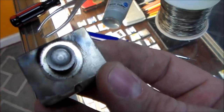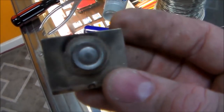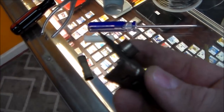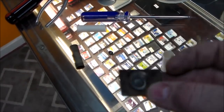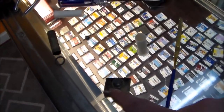The last thing that it can possibly be if you have trouble is the coil stop. The coil stop is just a little metal piece that the plunger hits when it pulls in. Sometimes these will give you trouble — you can see how the end of it's not flat. Sometimes if you have problems, the coil stop is just so worn that it needs to be replaced. A good place to buy all this stuff for electromechanical games is from the Pinball Resource, pbresource.com. They sell a lot of the electromechanical stuff. Chicago Coin may have even been using Williams stuff in their machines or a copy of it.